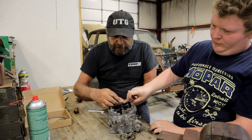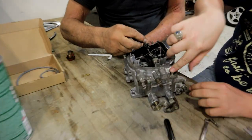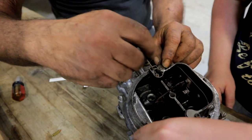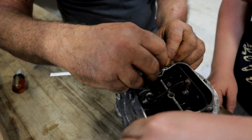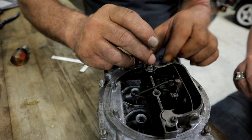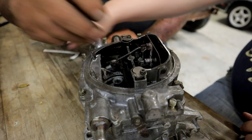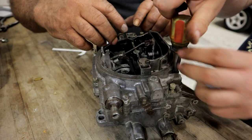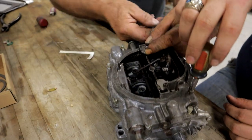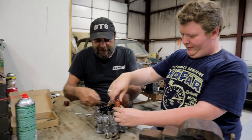We got our drop rods — the metering rods — that have to go back in. You get these springs, drop the spring in the hole first. Make sure this thing moves freely, because these are vacuum operated — you don't want any binding. A quarter-inch box wrench works if you can't find the right Torx screw — that's what the hex head's for.